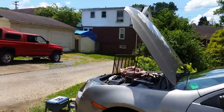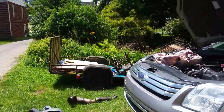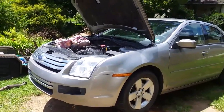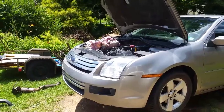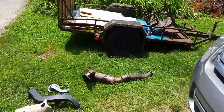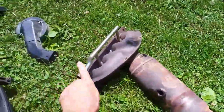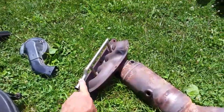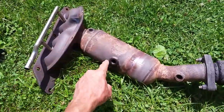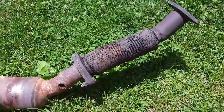We are working on this 2008 Ford Fusion and I had to pull the exhaust off. There are a lot of issues with these 2.3s, especially if you have the California or New York emissions. You basically have a catalytic converter coming off the back of the engine, three O2 sensors, and this air tube pumped into the top of the manifold. You've got a sensor here, an O2 sensor, one inside the main cat, one down here, and you've got this flex pipe.